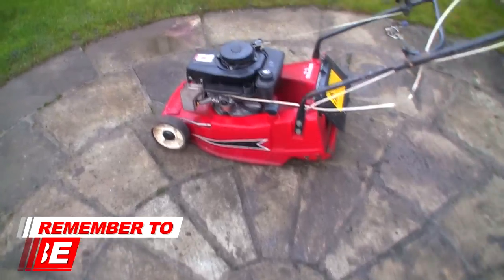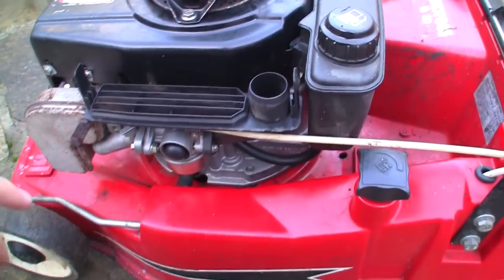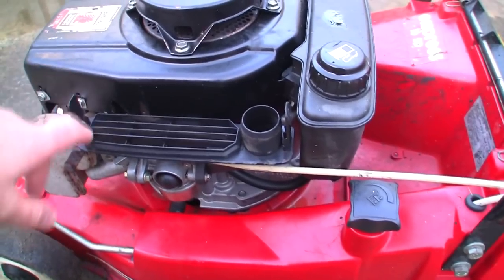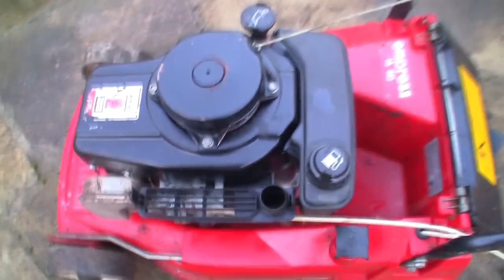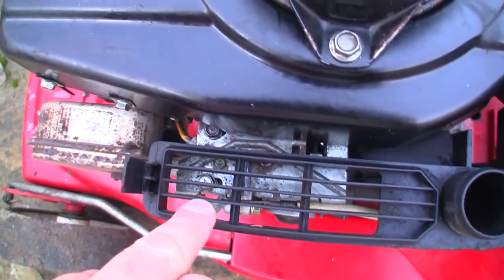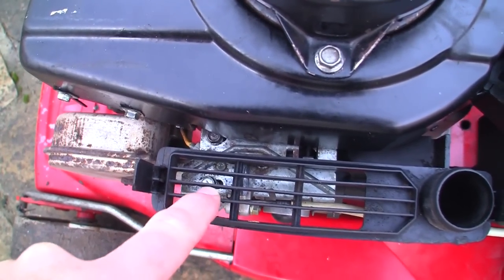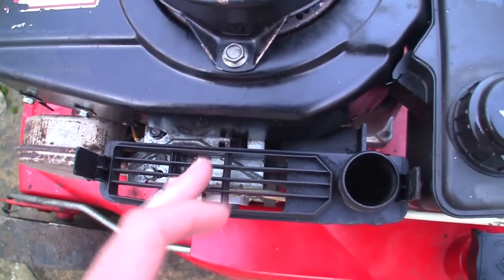So I've just looked back at some of my own videos. I've also been on a chap called Bruce Pender, P-E-N-D-E-R. I'm sure some of you have followed him on YouTube. He's got one on a Tecumseh setup, and he said this plate at the top here, you see where these two screws go in below the air filter? They're actually like cutouts there, so you can move this plate across each way to adjust the speed slightly.